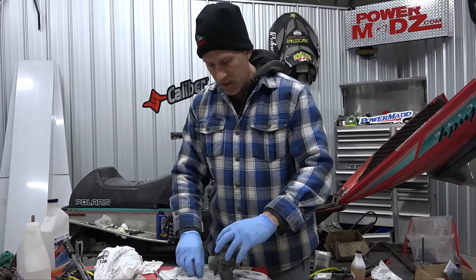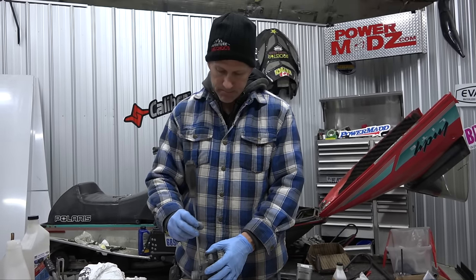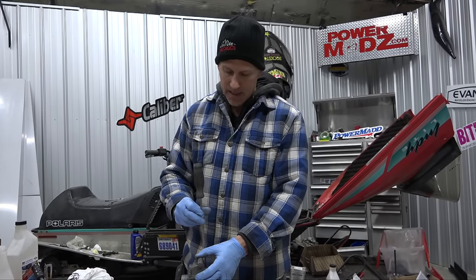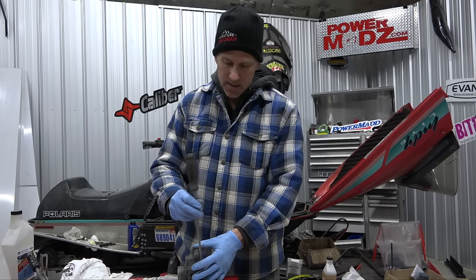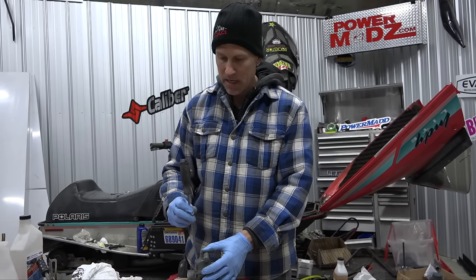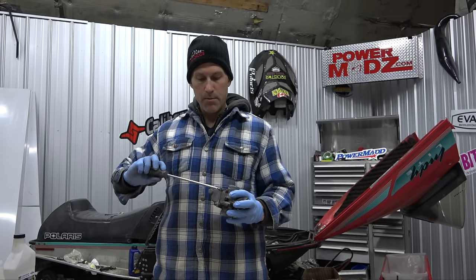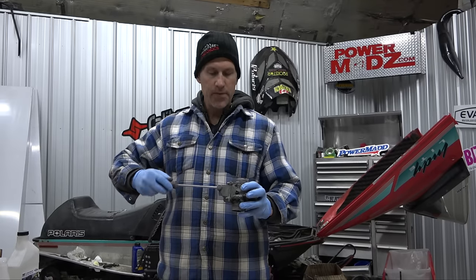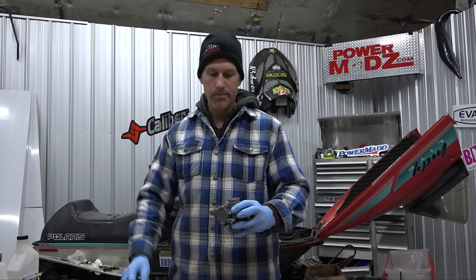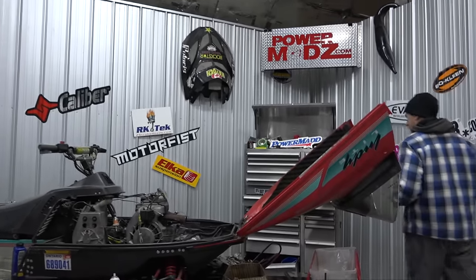These are set up bang on, so we didn't really have to rebuild these carbs, but you can look back at my videos - a lot of the sleds I've worked on, I've rebuilt the carbs. Those are the key basic principles though: new jets, new needle and seat, or it's not even worth your time taking it apart. You do have to be careful on some Ski-Doo models because of fuel mixture issues - they'd run different sized jets from side to side, like a 190 on one side and 180 on the other. You can't mix those carbs up when you put them back.